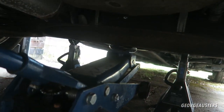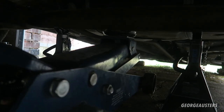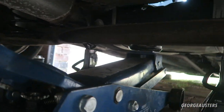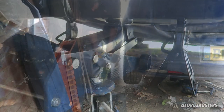Just to show the setup - this is a fixed rear beam axle. I've jacked it up in the middle of the axle and put the axle stands either side, then left the jack still supporting it as extra support. Good to go.